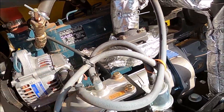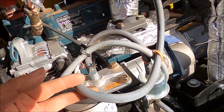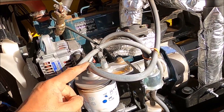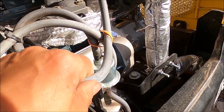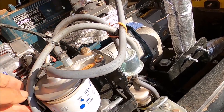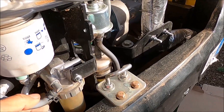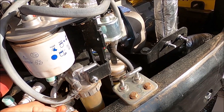The reason I ended up routing it up here is because I didn't have enough length when I trimmed it — I wanted to use the same hose and didn't have a new one at the time. I always intended to replace it with a real fix. It's not a one-off thing — this is definitely cheap quality, as you can see everywhere. It's just about to break. Not only this one, but this one started to leak and crack up, and the other shorter hose also cracked up. Fuel is already coming out as we speak.